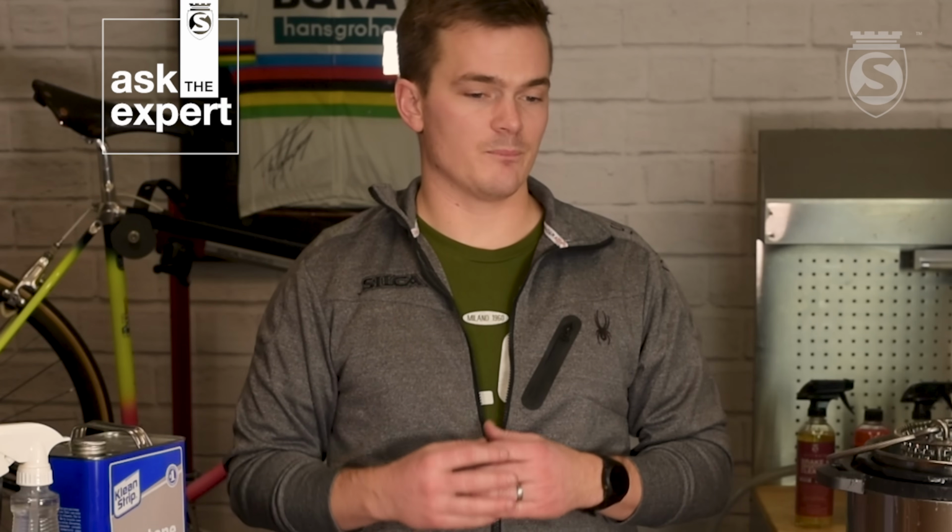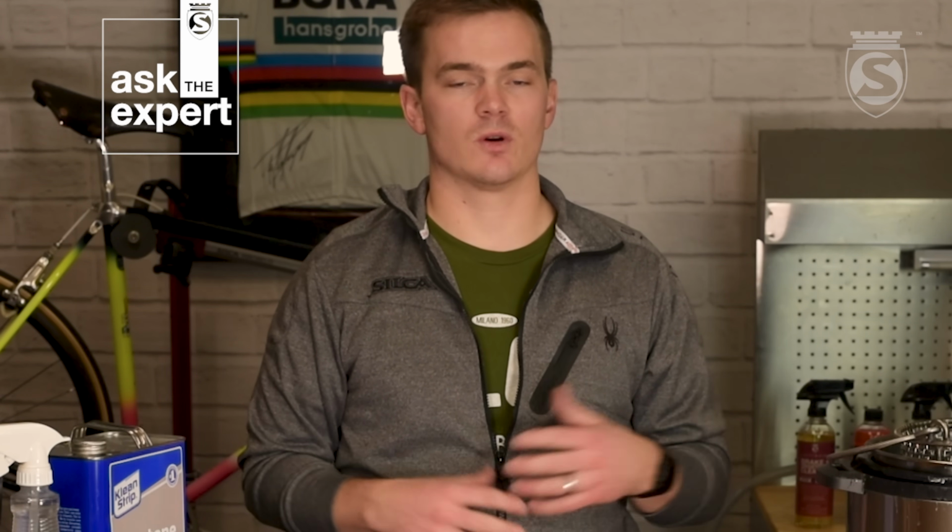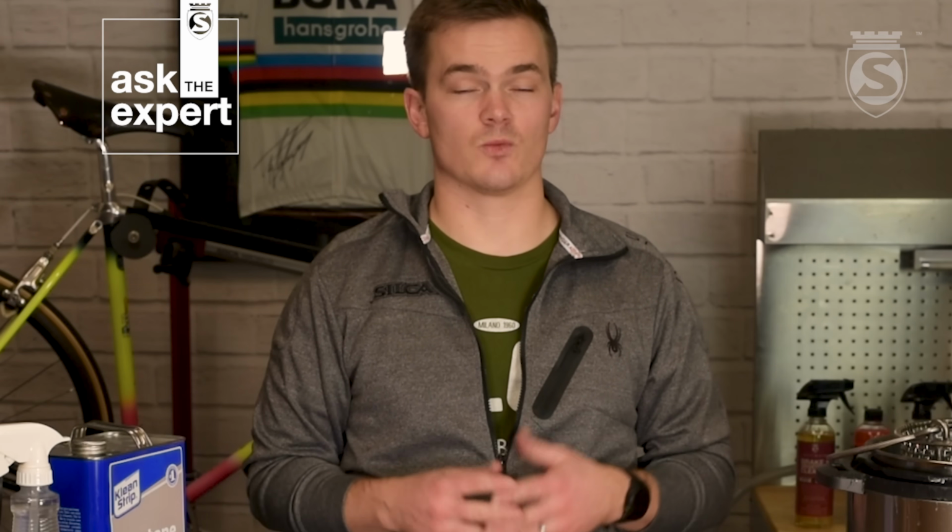Or if you want to hot wax, you can take the chain back off and wipe it down with a microfiber towel, just a clean rag, and drop it right back into the wax like we're doing right now, and start at the end of this process. So it's really easy to take care of. The one big thing you want to look out for is water. There's no oil in the chain lube or in the wax, so if you go on a long rainy ride, something like that, you really want to get that chain dry as quickly as you can.